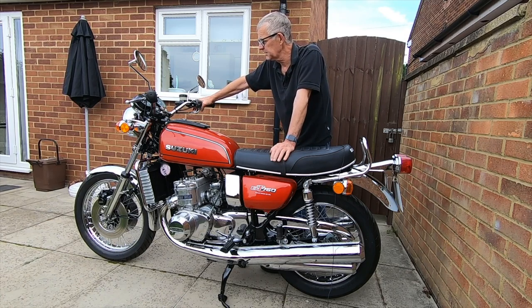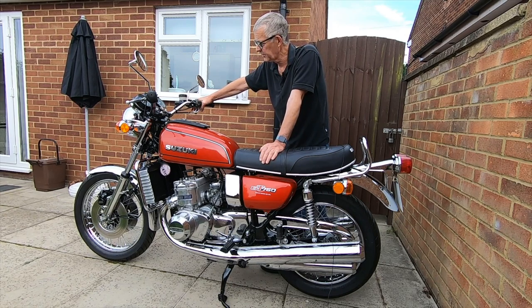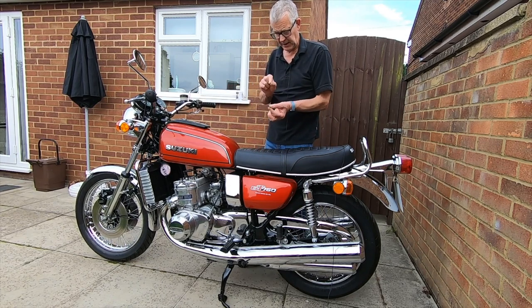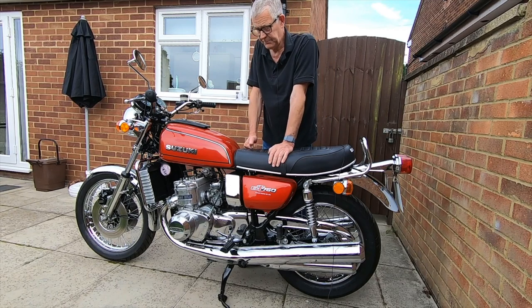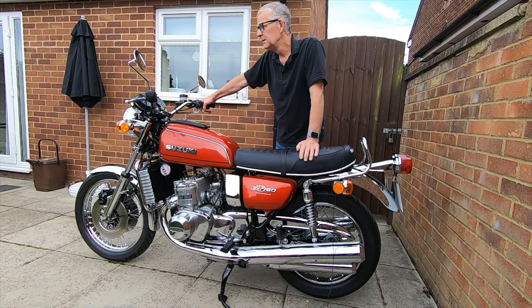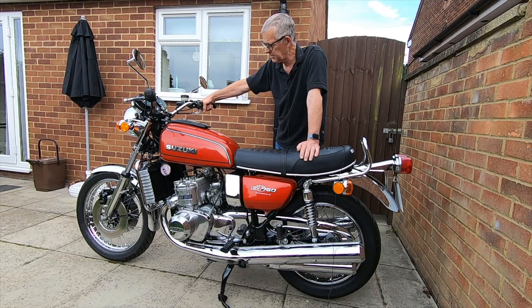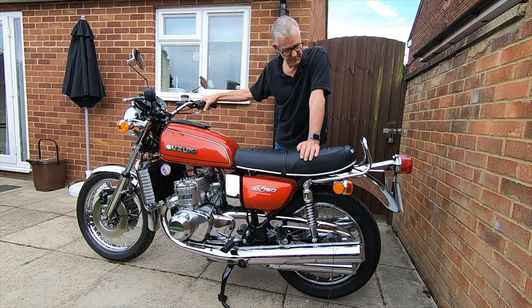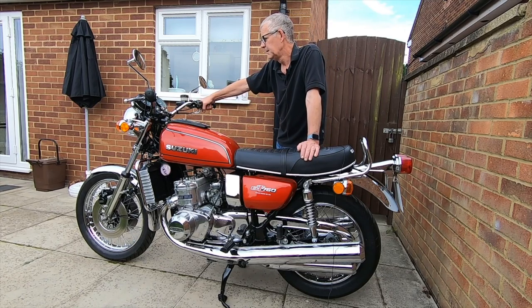There were a few teething problems: the temperature gauge wasn't working — I sorted that, just a wiring fault. I kept the original wiring loom and repaired it — tidying it up, cleaning those little block connectors by bending the tag down, pulling the pin out, and cleaning it up on a bench wire brush. New looms are £300-plus and this one wasn't that bad; it's done 28,000 miles, which I know is genuine because it's been off the road since 1984. It's a 1976 bike — by 1984, 28,000 is about right, and the original paintwork backs that up.